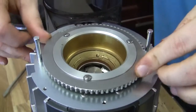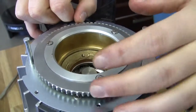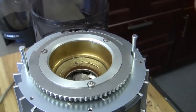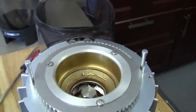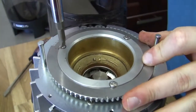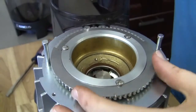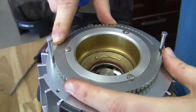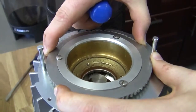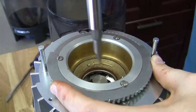We'll probably be about right there. Keep in mind, that's just going to get you close — our big goal here is to be within range, to start our dial-in. Because otherwise if you're not even close, you're going to waste a pound of coffee. This just happened to work out well for me, that I'm nice and level. But if it wasn't, you'd want to loosen these three little screws, and then this will spin. What this does is it stops it and gives you a set point so that way I'm not just unlimitedly grinding. We can go ahead and tighten that back down, nice and level.